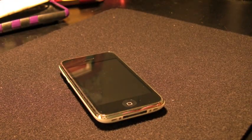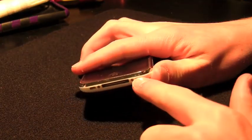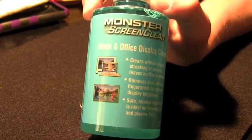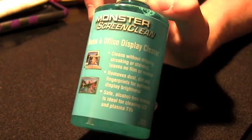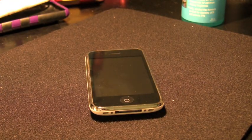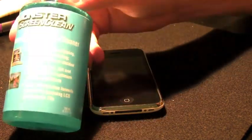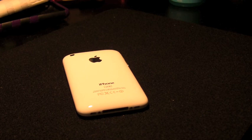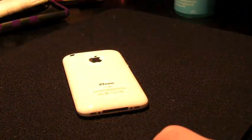Now we're going to go to actually cleaning your device. The best way to remove fingerprints and grime is to get a screen cleaner. This is Monster's screen cleaner — I bought this for $15 with the microfiber and the bottle. There's also a company called iClear that makes really good stuff. You want to go out and buy an anti-static, non-alcoholic cleaner. Make sure it's alcohol-free and ammonia-free — absolutely no Windex, no Glass Plus, none of the household cleaners you have laying around, because they will have ammonia and alcohol. These can streak and ruin the oleophobic finish and can physically take the paint off the back of your iPhone 3G.